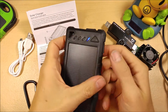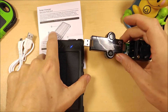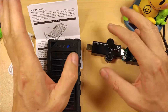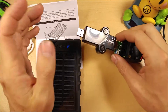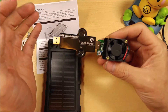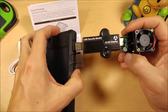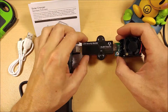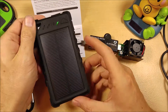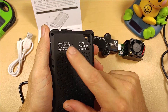Overall, as a battery bank it's very simple and easy to use. You just press the button, plug in your device, and go. It did fully charge my iPhone 6s Plus and my LG V10 without an issue — gets up to 100% and stops. I tested it using a constant current USB multimeter. At a one-amp rate plugged into the one-amp port, I got a milliamp hour rating of 7804mAh.